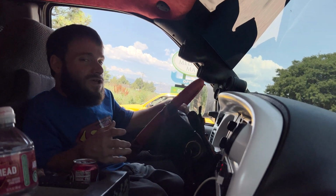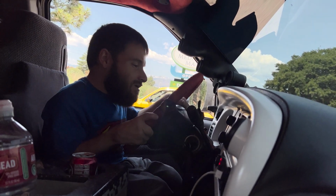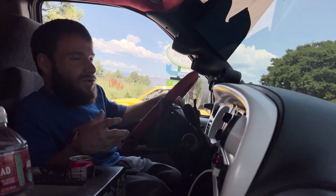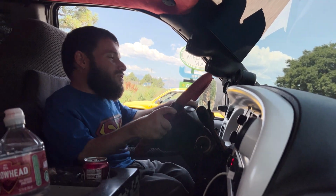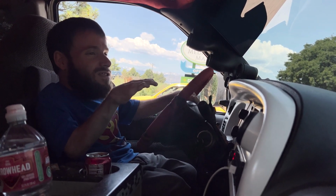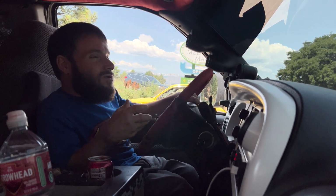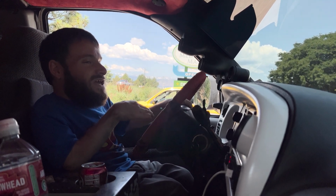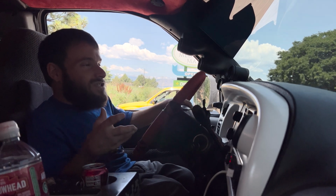I forget where we left off, but I've been driving around on these injectors for like 2 weeks now. And the biggest issue with the last set was that the pop pressure was set a little bit too high. So when you're in a parking spot that is angled to the back like this one, and you try to reverse out of it, or like if you reverse out of our driveway into the alleyway, and you give it a little bit of gas to get over the driveway hump, and then you let off so you don't hit the fence, it always wanted to die.